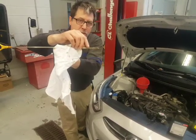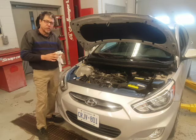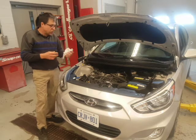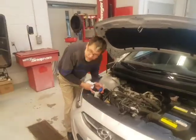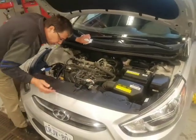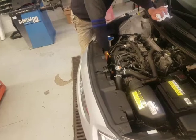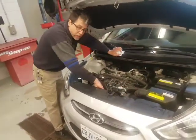I'm going to button up this engine and put the oil change sticker on. Since we have the car in the shop, we can visually check the rest of the fluids. Most containers are clear so we can check fluid levels without opening them. We can check and top up washer fluid — I can see it's there. We can check coolant: I can see it's dark up to the max line in the reservoir, so it's on full. Don't take the coolant cap off — you'll get burned. Always check the overflow reservoir.